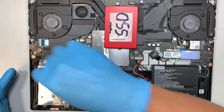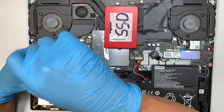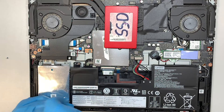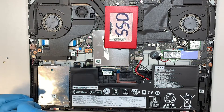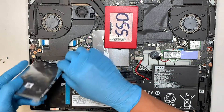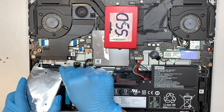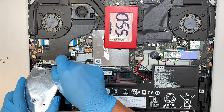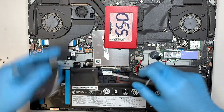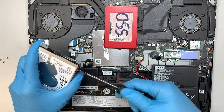The next step is to get your Phillips screwdriver and remove the four screws holding the hard drive. Once done, lift up the hard drive gently — do not break the cable. Disconnect the SATA connector; use your fingernail to push the connector away from the hard drive. Once removed, also remove another four screws from the hard drive, because we need to reuse the hard drive bracket and move it over to the SSD drive.